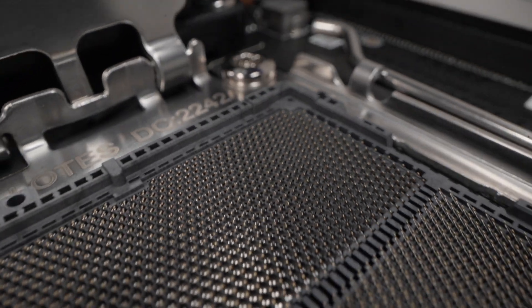The CPU and GPU are both way outside what this case should house, so I wasn't expecting outstanding temps. With a mild undervolt on the 7950X I was able to get a solid 34,000 in Cinebench at a max temp of 90°C. On to gaming: I ran several titles with this setup. In Microsoft Flight Simulator, where you see 100% CPU usage, I was getting 85°C. In other titles where the GPU is doing most of the work at 100%, it reached 75°C. Those aren't really bad temperatures, but it does mean those fans are spinning at like a thousand percent.